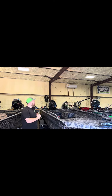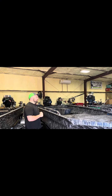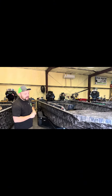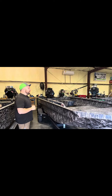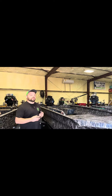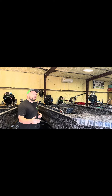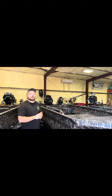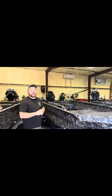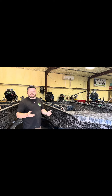Hey everyone, this morning we were putting a turbo system on a new Mudbuddy 5000. This is brand new, on a Havoc MSTC. We noticed that Mudbuddy made some changes straight from their factory — the biggest one right out the gate is that Mudbuddy is now putting MLS head gaskets on their 5000s, which was a great move. As we all know, head gasket failures can lead to catastrophic engine damage.